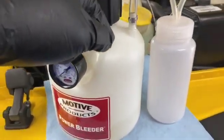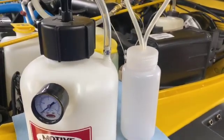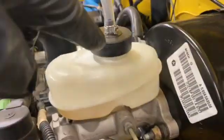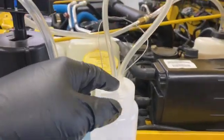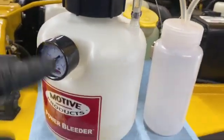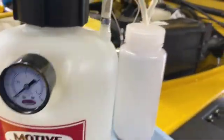So you've got this main tank here which has a handle, and that handle's a pump. You can pressurize this tank. You put the brake fluid in there and you hook it up to a hose onto your brake reservoir, and then you take this overflow and hook it up to the wheel cylinder and put that on the bleeder valve. Pump this thing up full so that it's got maybe 10 or 15 PSI, which pressurizes the whole system.